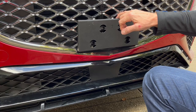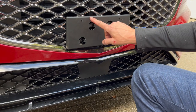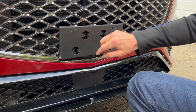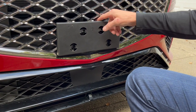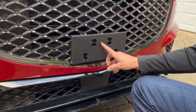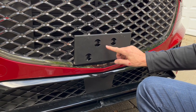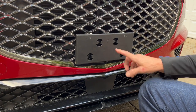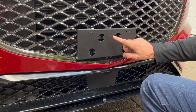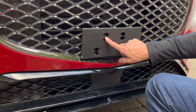Then I realized that behind the grille is a soft plastic piece — you can reach back there and feel it — and that plastic piece is shaped somewhat like what's up here. In other words, the plastic piece behind the grille is narrower at the top and wider at the bottom. You'll also notice that this plate has an arrow on it, so that has to go up. You have to have the bracket with the arrow up, because the plastic piece behind it wouldn't attach properly otherwise. So if you don't have the arrow up, you're not going to hook it in.